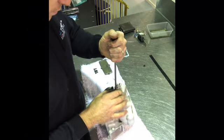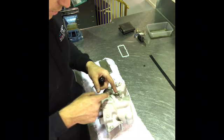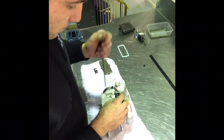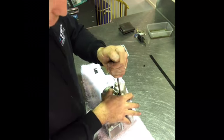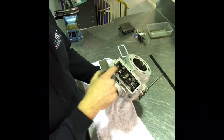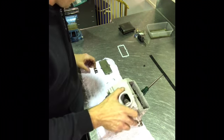It's quite normal when you're running the bike as well, by the way, to have a little bit of exhaust gas coming out of this. Obviously this has a hose attached to it. Sometimes when you rev the bike, you'll see some gases coming out of there. That's quite normal. It's just because the Powervalve system itself isn't perfectly sealed, so you do get a bit of exhaust gas ending up in this chamber here, and that fitting there is how it vents out and dissipates.